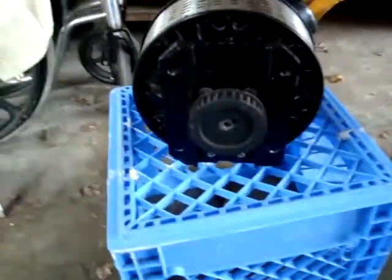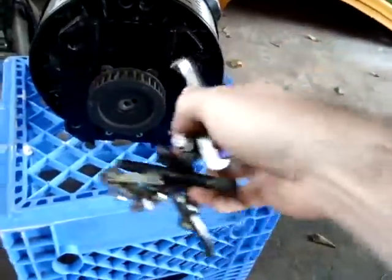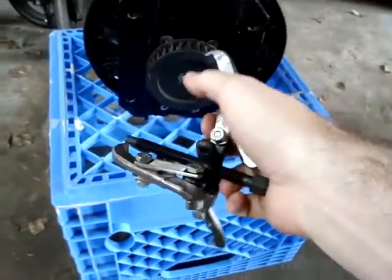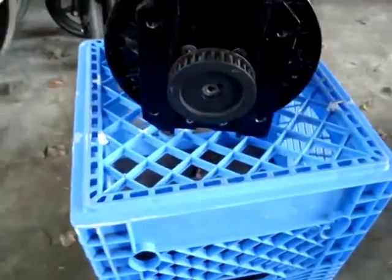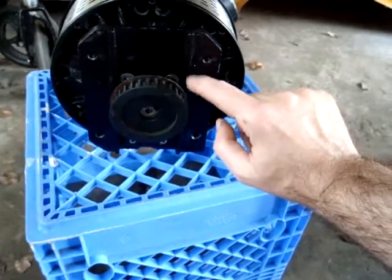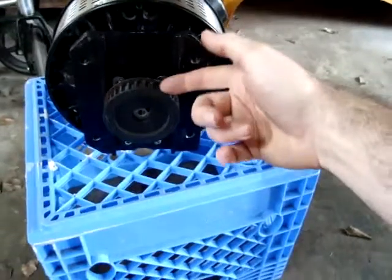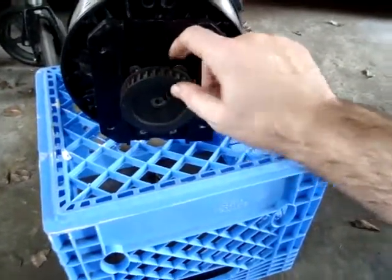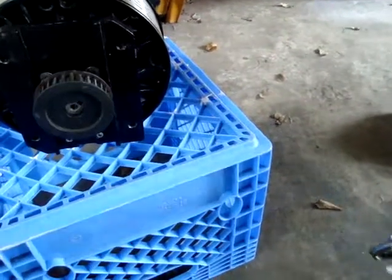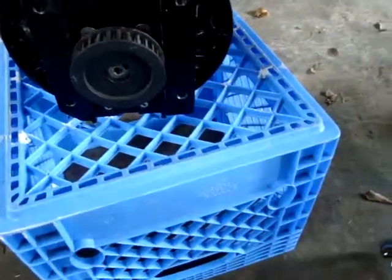But to remove the pulley from the motor, I have a puller tool here. These three little prongs went around the pulley in various places, and then the center bolt just unscrewed the whole thing, pulling it out. You don't want to pry this out with a screwdriver or you'll risk bending or warping either the housing or the pulley itself. If I didn't have one of these tools already, I would have gone to O'Reilly's and just borrowed one of their steering wheel pullers — they loan them for free and you return it.